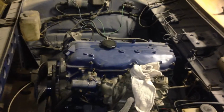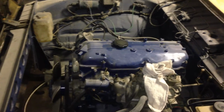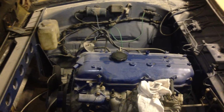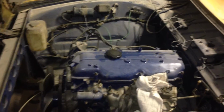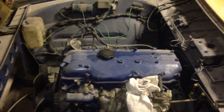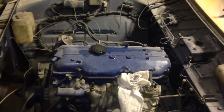The second motor I was thinking of, because it's a very common motor in a front-wheel drive car, is a 3100 V6 out of like Luminas, Venture Vans, Impalas, like the newer Impalas, but that motor is only offered in front-wheel drive. So I've done a whole bunch of reading on the internet, and I was going to get a flywheel, pressure plate, and throwout clutch and bearing from a Cavalier, and an S10 transmission that's bolted up to one of those 2.2 S10s, the 4-cylinder ones, and apparently it would work.